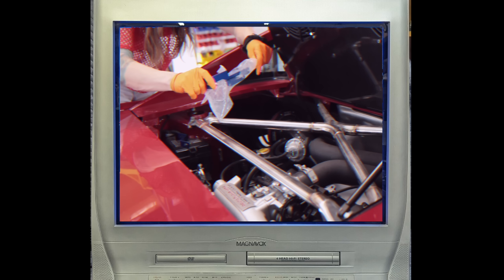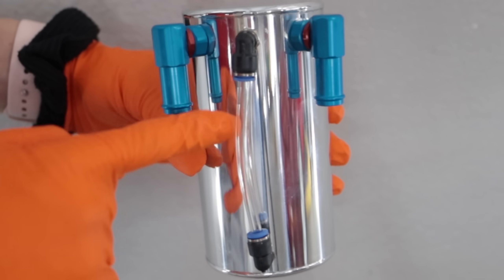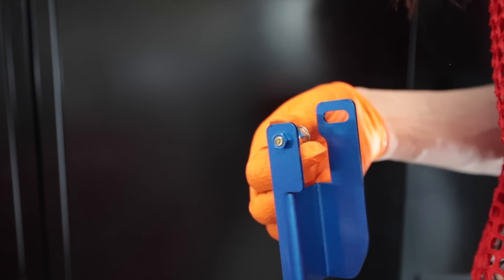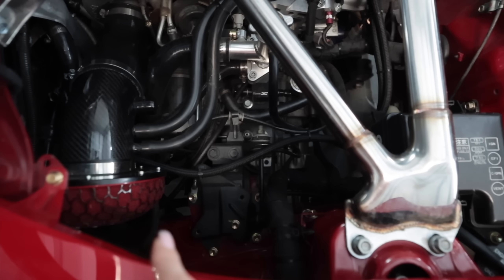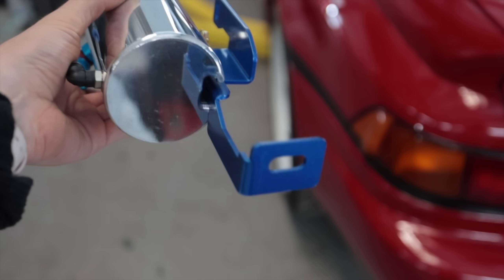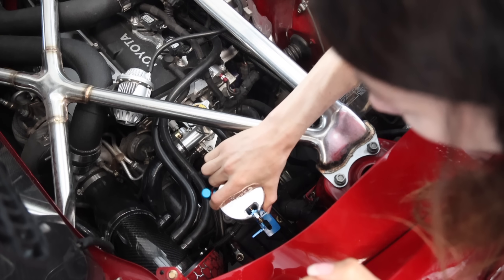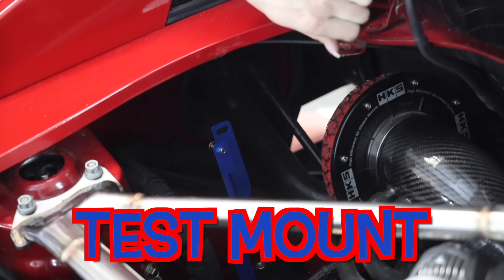Bracket shapes. This little reservoir is where the oil is collected. There's a little sight glass right here so you can see the level. The bracket slides into this little notch right here. This shape has to be made to fit the other shapes. Down in this vicinity is where the original air box as well as coolant neck went. You can see on this transmission mount bracket there are some threaded spots, which is why I chose the one for a GR4 Corolla. Right here — that is perfect. It just barely tucks under the side blade panel.